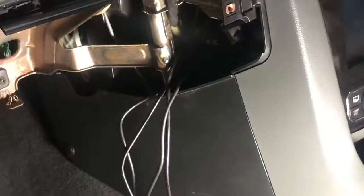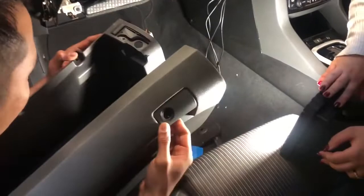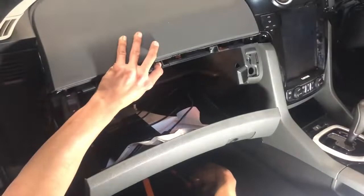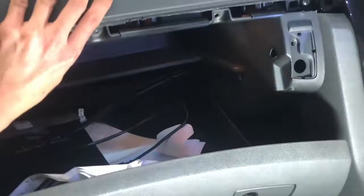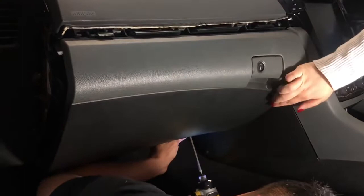Put that little metal screw back in — that holds it perfectly. Now we're putting the glove box back in. Just like the way we took it off, we screw everything back on and put everything in order. Make sure you don't put any extra bits in first or you'll get stuck with the glove box. Plug in that plug — that's for your glove box light. We'll put all the screws in, probably do the center one first then one on each side to keep it steady, then do the rest.